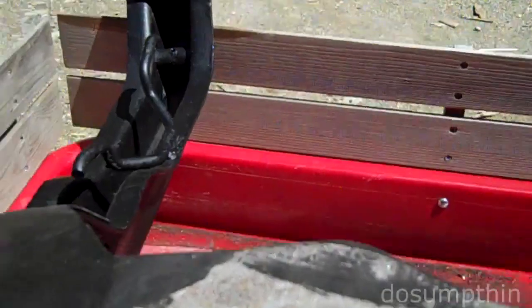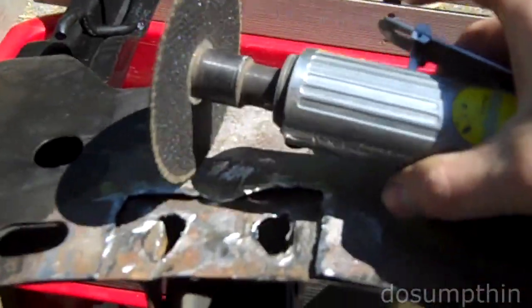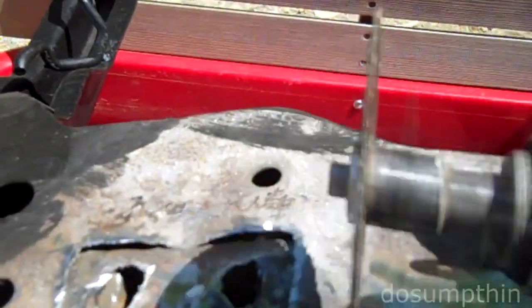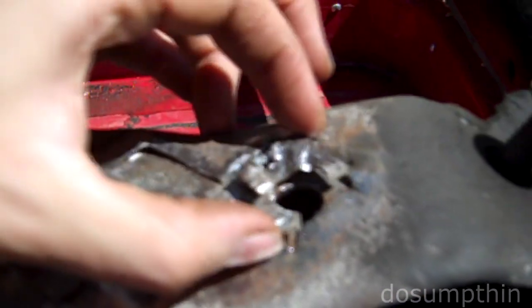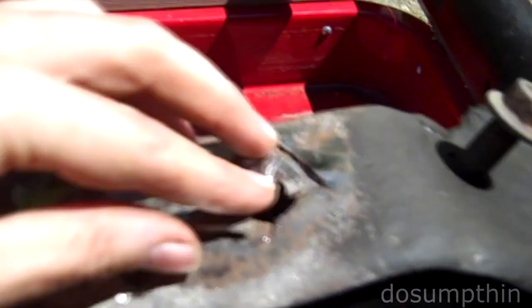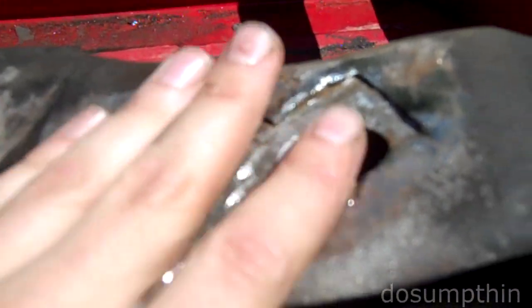What I did is I used my cut-off tool and went and cut around the bad parts. These are the pieces that I cut out — I cut out the rusty parts. This one got me down to the next layer, and that doesn't seem to be compromised. I tried to get underneath these edges a little bit to get any flakes of rust out of there real good.